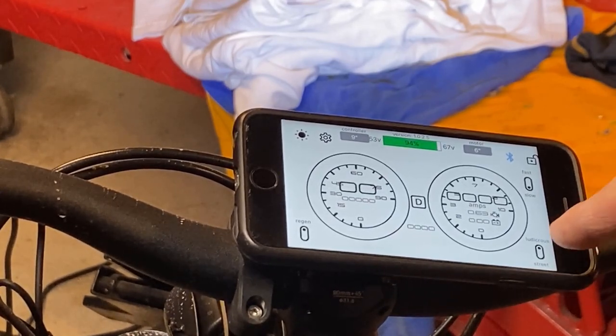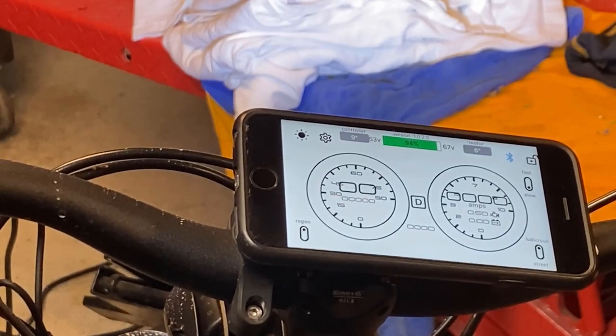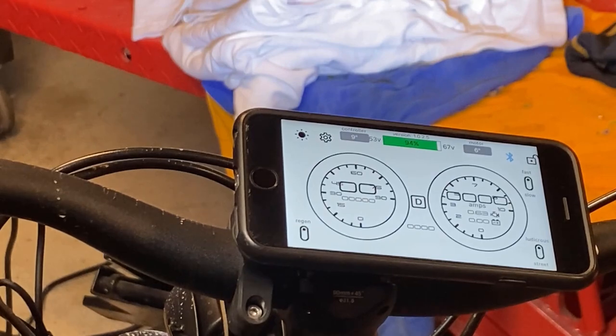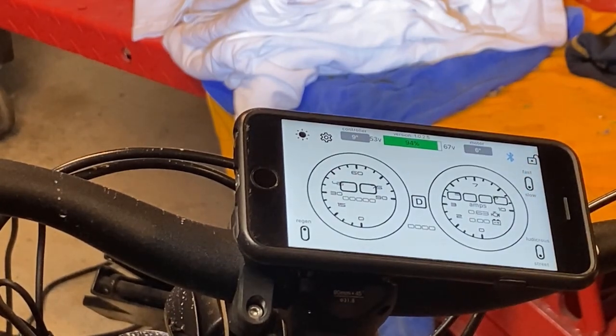So the way I have it set now, ludicrous and slow, in theory, I should have a full 7,000 watts available. However, I'm gonna cap out at about, it says 30 miles an hour. In reality, that's probably 25. If I were to change it to fast, now I should be full ludicrous mode. Full power, full speed. Street, in this case, is gonna knock me down to 5,000, but as fast as I can possibly go at 5,000. And slow street would be 5,000 capped out at 25 miles an hour.